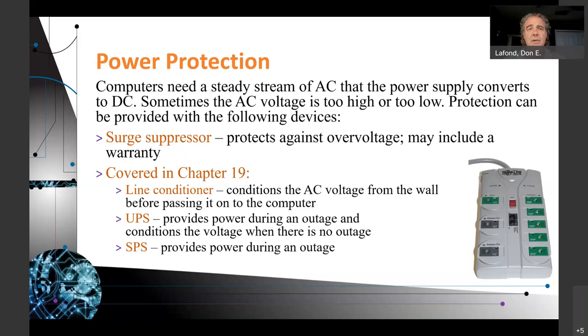I highly recommend buying a UPS. They're more pricey than you'd want — a UPS can cost anywhere from $50 to $400 or more, depending on how much wattage your computer draws. The UPS has to be rated for the power that's in your equipment. For my computer connected to the 1,600-watt power supply, I couldn't afford a UPS to provide conditioning for 1,600 watts, so I had to go with a surge suppressor. Brownouts are common in Florida and I really wish my mining rig was connected to a UPS.